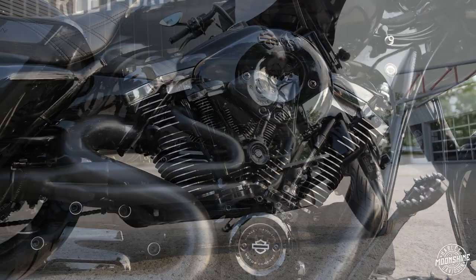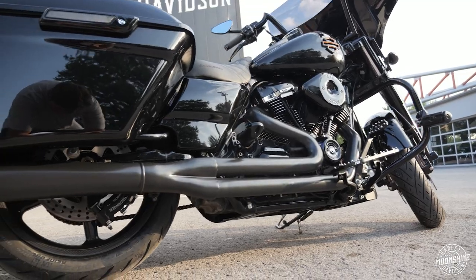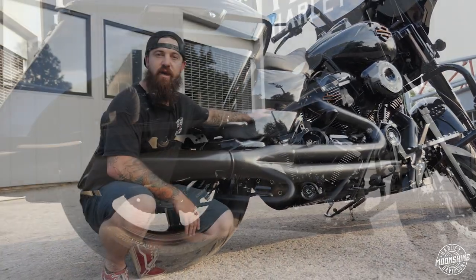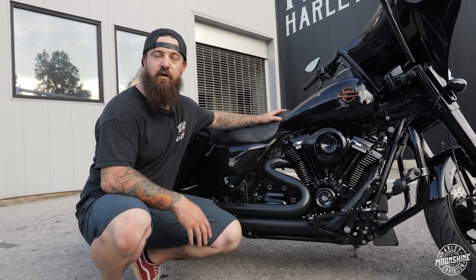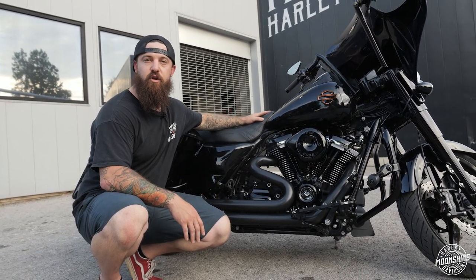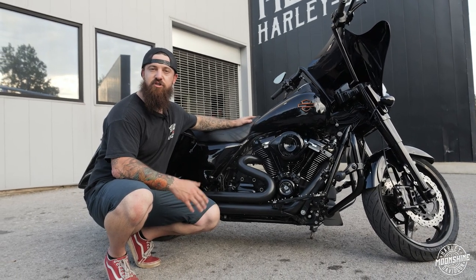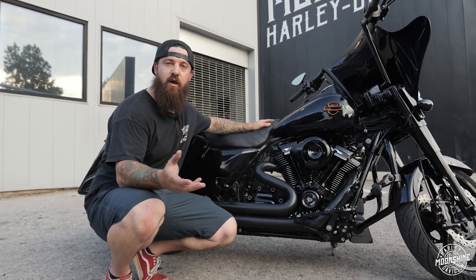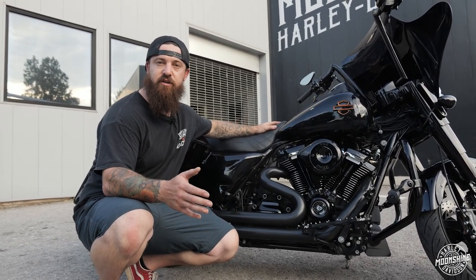And then we pair that with, of course, our Monster Series 2.5 heads. On this setup here, we ran a stainless valve. It's still a 2.5 millimeter over valve, but we ran the stainless. A little more cost effective, still a great product on the top. We use Gorilla rocker shafts from Fueling on top. The reason why we run those is that they are so strong, they're not gonna gall and ever leave material on the rocker shaft, so it allows us to have the strongest unit on top if the motor ever did get hot.